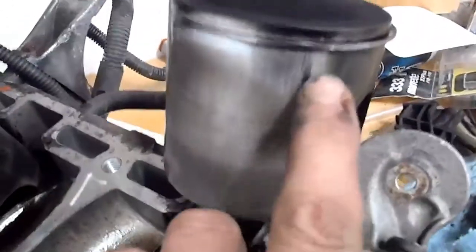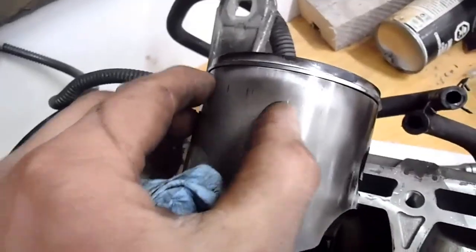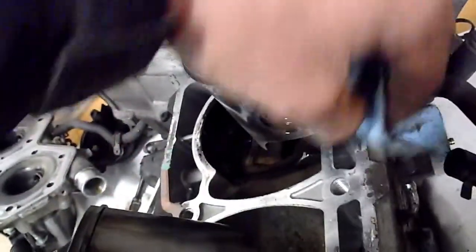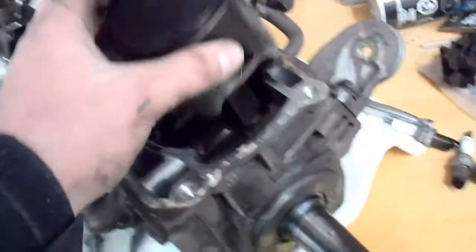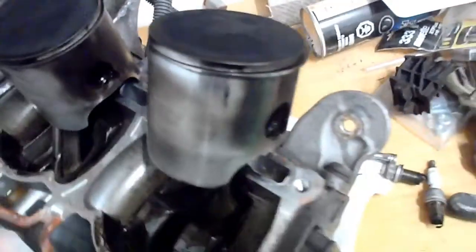So there's the PTO side. Doesn't look like they're really heated up. See a little bit of scuffing right there — I can just feel it barely with my fingernail. Definitely minor. Let's turn it over and get that other piston a little higher up and get the oil off it. This one's in even better shape, a little bit of scoring — I can feel that one, but all in all it's not in bad condition. Original pistons obviously, single-ring pistons. The pistons look good. A bit of carbon on the top, not much for wash. But not being a carbureted snowmobile, your pistons are going to read different anyway.